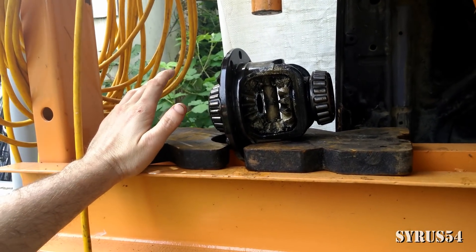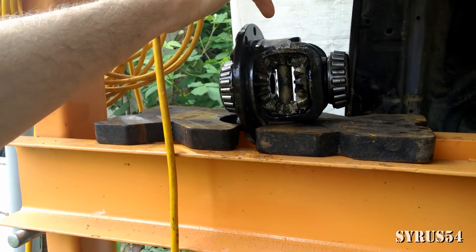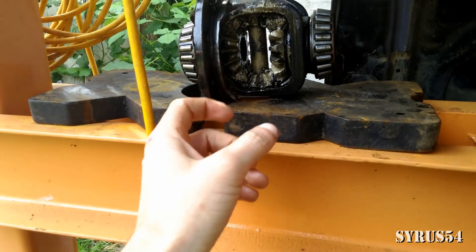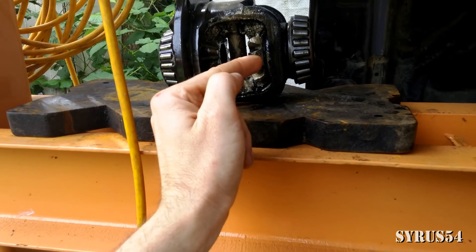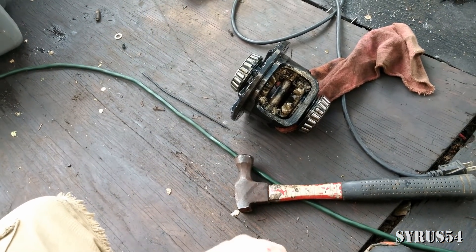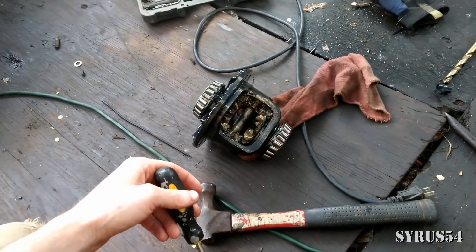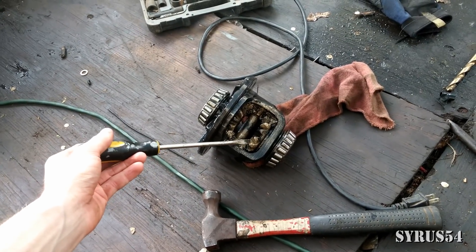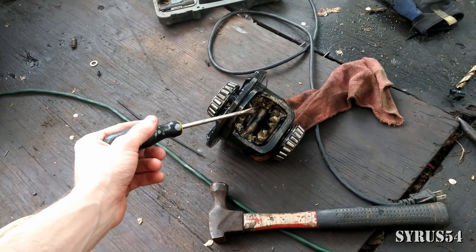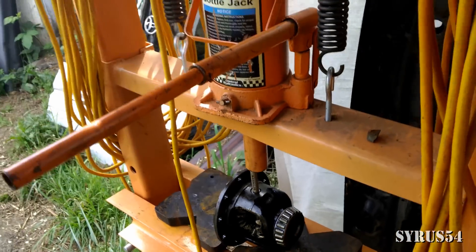Now for my carrier here I went the original route of just welding everything together so that I had two-wheel drive. I'm going to have to break all of these welds because I have to try to press this pin through, get those two top gears out, and once those two gears are out I can pull this one out and then pull this one out — and that's where my new locker is going to sit. You're going to need your chisel or screwdriver and hammer to start breaking all of these welds. If you've already got the locker and haven't welded it, good for you, but for the rest of us we're going to have to go through this process.